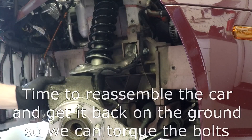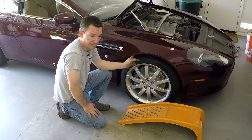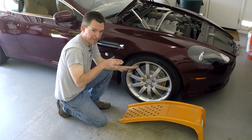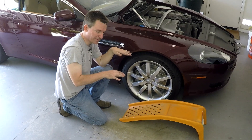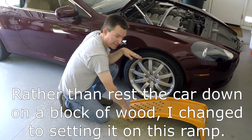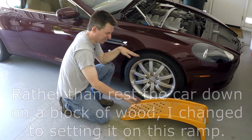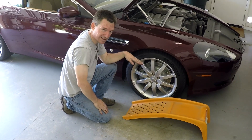We've got our arm reassembled, our bolts reinstalled but not torqued - which we can't do until I have the whole car put back together so I can load it up. I thought I could park the car on the curb to get access to the bolts but there wasn't enough clearance for the wrench. So I'm going to resort to plan B - put the car up on a set of ramps. I can't drive onto the ramp so I'm going to jack the car up, slip the ramp underneath, then lower the car back down so its full weight is sitting on the ramps.